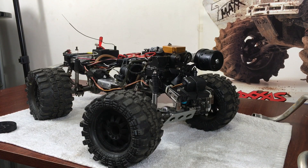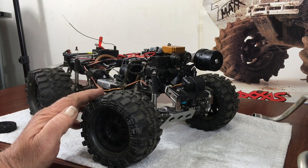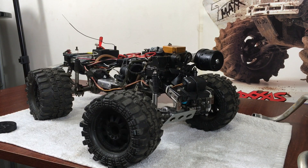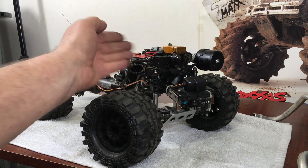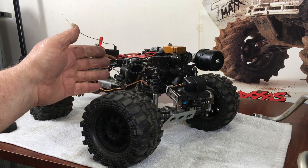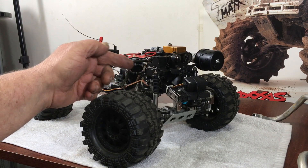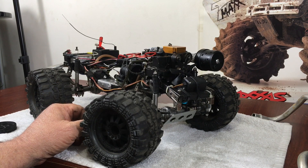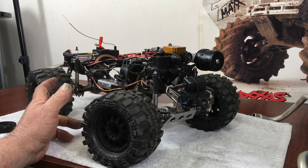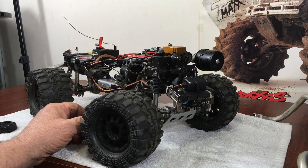Now the flywheels you buy from Sterling Engine don't screw on — they just slide on and set against that crankshaft boss. Then you can snug down your pilot shaft for your clutch and that'll hold it tight. That's the simple secret for how to get the flywheel off.